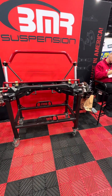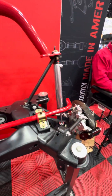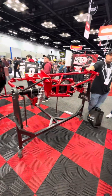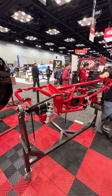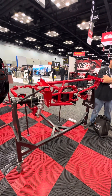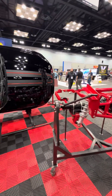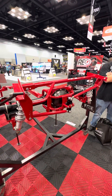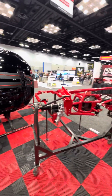What's this one? Challenger and Charger. Is this a fourth-gen Camaro or F-body? That's a first-gen. That's a torque arm system. With this system, the rear end goes straight up and down — it doesn't go side to side. On my fourth-gen, the axle would move horizontally as it traveled.